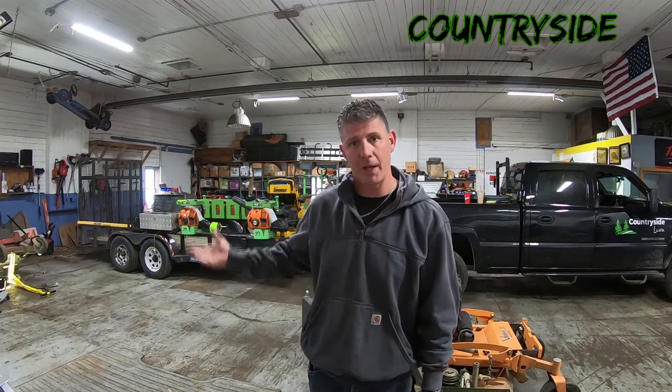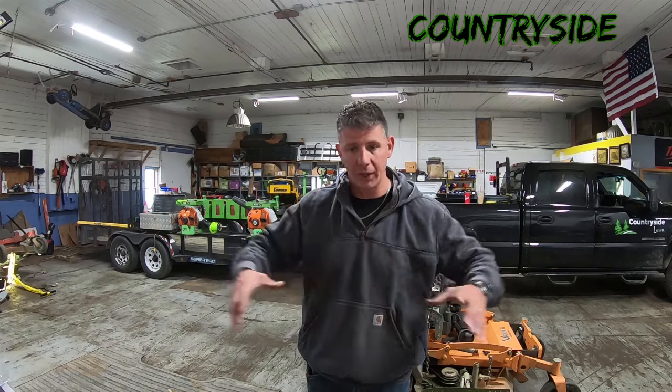You're fine. Keep an eye on your belts. Make sure there's nothing in the shroud or in the deck, sticks, rocks, acorns, pine cones, anything like that that could get in the way of your belt or your pulleys that are going to take chunks out of your belt or cause wear and tear, anything that's going to cause premature failure of the belt.